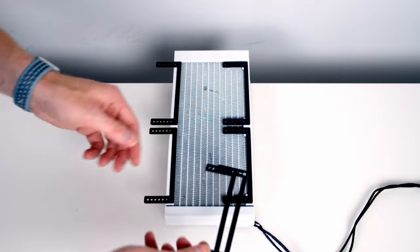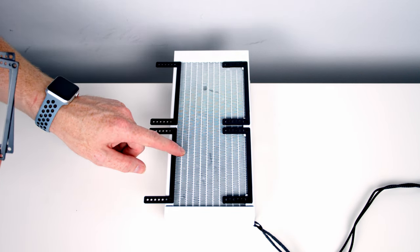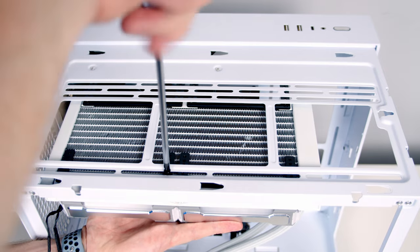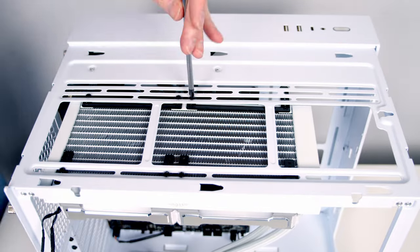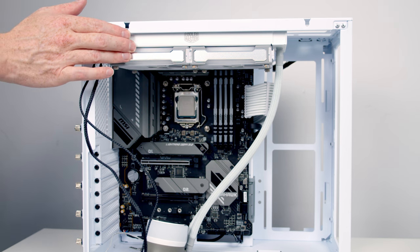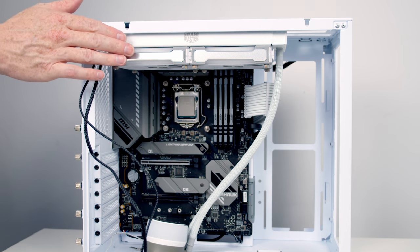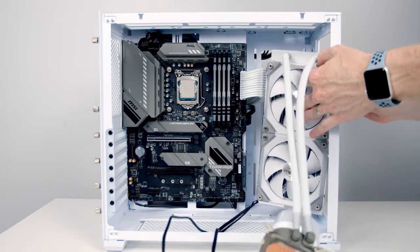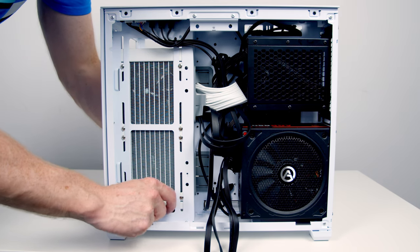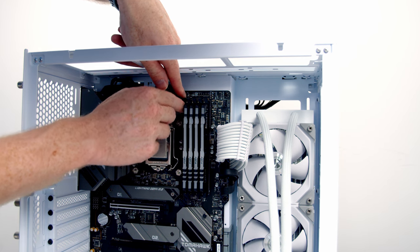Lift the radiator into the case and secure with the screws marked B. You can see how this moves the radiator all the way to the front of the case, meaning it fits with a full-sized ATX motherboard. Well done to Lian Li for listening to feedback about the original O11 Mini and providing this option. As I mentioned I won't take this option for this build, so I'll remove it and install on the side. Set the radiator in at the side, bring the fan cables down through the underside, then bring the 4-pin PWM cable up through the cutout at the top of the motherboard and plug it into the CPU fan header.